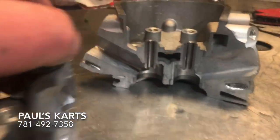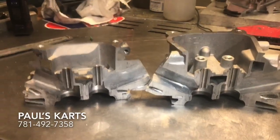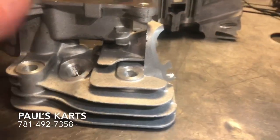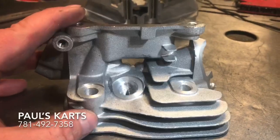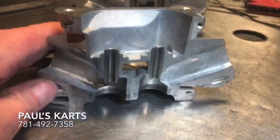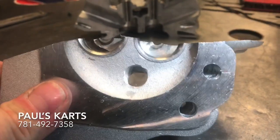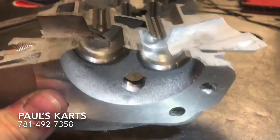This is how I made the cut, and this is what we're looking at — pretty cool, right? So this is the front of the head. This is the front of the GX 200 Honda casting, cut in half down the intake port and the exhaust port, cut through the guides and cut through the seats. Pretty radical chop.